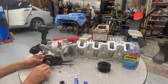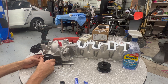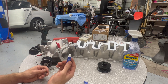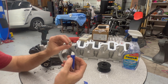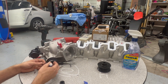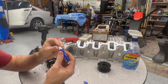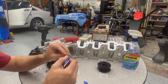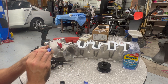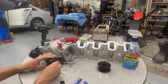When you first get the pulley on, depending on the size, check to make sure there's no rubbing. The snout has some variation, so if you go smaller than about 2.4 inches it could start rubbing and you may need to sand or grind the snout. I've got blue Loctite in gel form — I like the gel, it's less messy. Only put it on the first five or six threads and don't let it drip, or you could end up sealing the pulley to the hub.